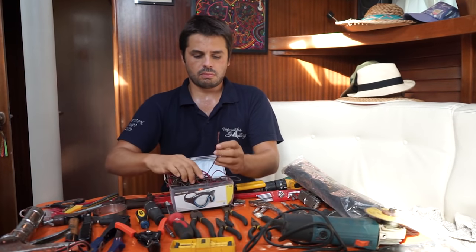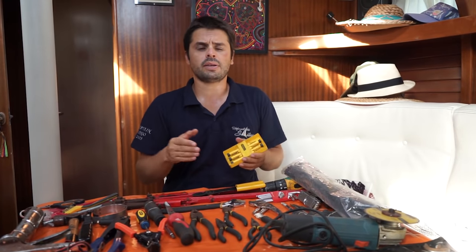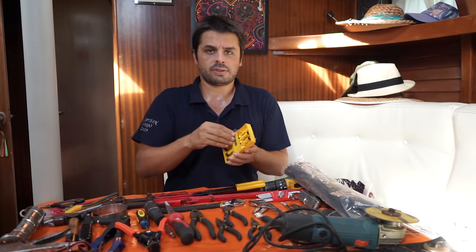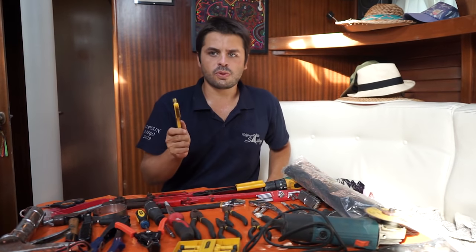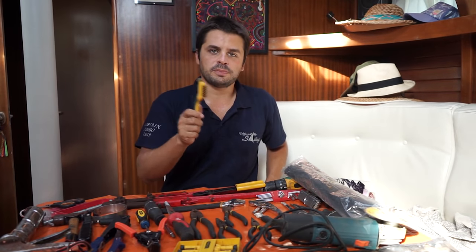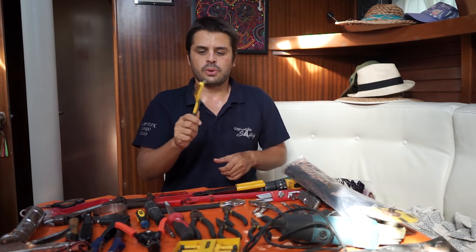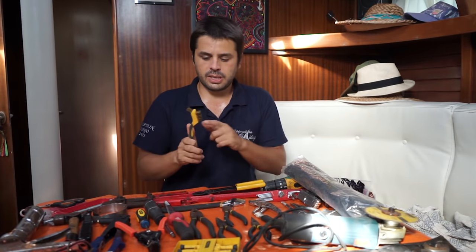Also, a nice set of wires in different gauges. For electrical or any other electronic stuff, make sure you have a set of small screwdrivers — flatheads and Phillips. Also for electrical, to clean terminals and stuff like that, it's a metal brush. You just apply some WD, like on battery terminals, scrub a bit with the wire brush and it's new again. Really cool and cheap.